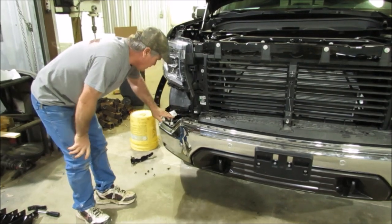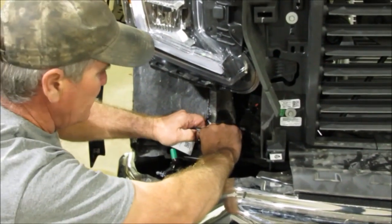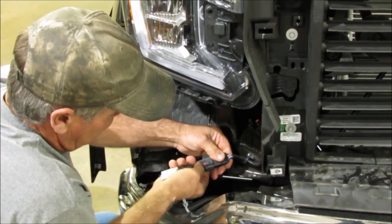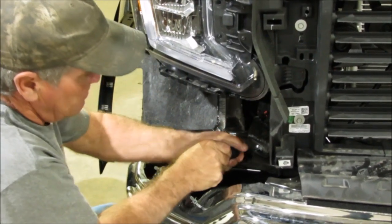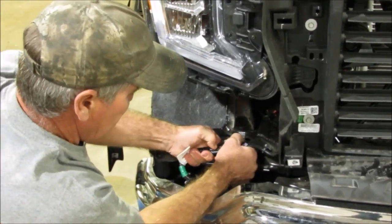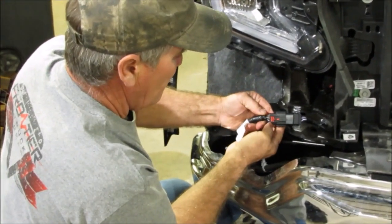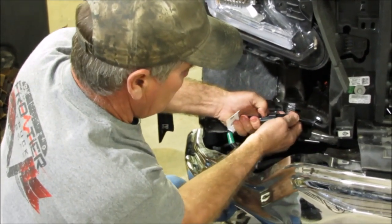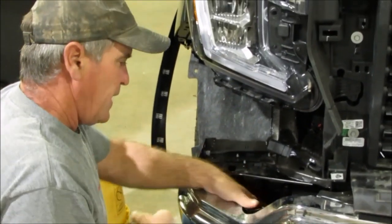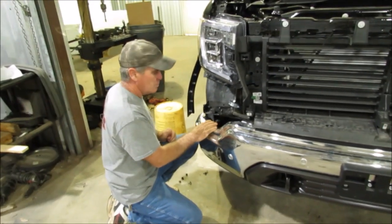And you're going to have your wire harness right here that you can pop loose as that wire harness goes with the bumper. I have to remember how to do that. I believe it's that little black thing right there that you punch down. If you get a little screwdriver, my fingers are a little bit too big to do that. You get a little screwdriver and you can push that down and it'll pop apart right there, but you got to pull that little thing out there first. I just need a little screwdriver to pop. There you go. And it's just like that. You just got to get it right and it'll push down and it'll come apart. Get that, and I'm going to show you a little more clear on which bolts to take loose once we get the bumper off of there, and we'll put it on the sawhorses.